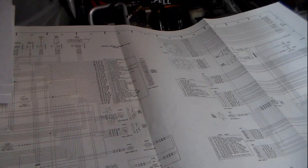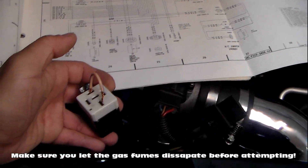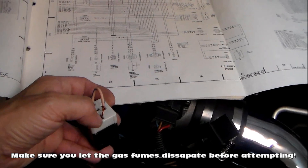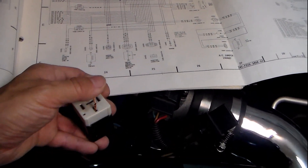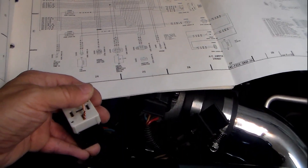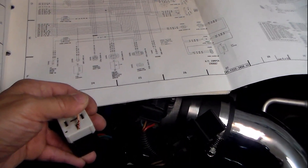With this particular car — our 92 Mustang — I dug up the wiring diagram and looked at the schematic for the fuel pump relay. Then I found the relay, which is over here close to the right side fender, so it's easy to get to. I found the wire that's hot at all times and the wire that feeds from the relay hot to the fuel pump, and I just rigged up a wire here. Right there you can hear the pump came on and all the fuel is draining out. I'll do this until all the fuel runs out of the system, and then I can go ahead and drop the tank.